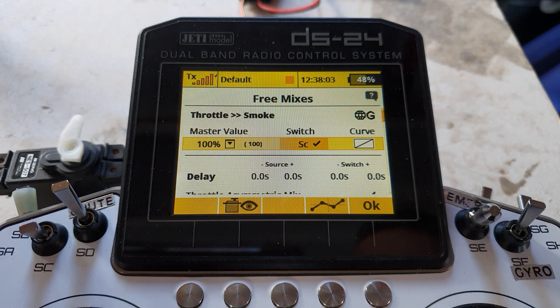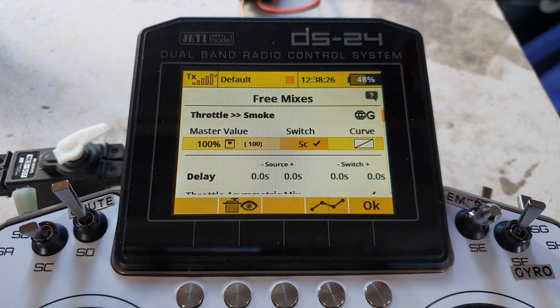So that's my throttle at idle. Servo's at 0%, what Jeti calls 0%, so it's at the mid position. And so if your pump controller counts the 0% in the mid position as being the off, there you are. And the entire throttle range from throttle at idle to full throttle works only in that half of the servo travel, so it's that half, the 0 to 100% travel, and lo and behold, there is your basic pump control.